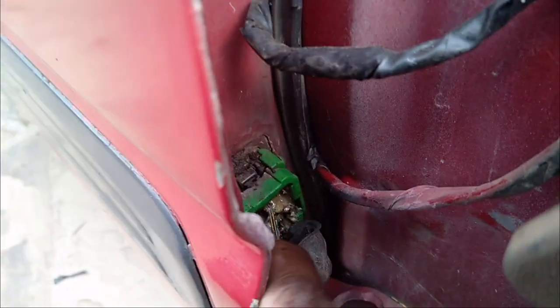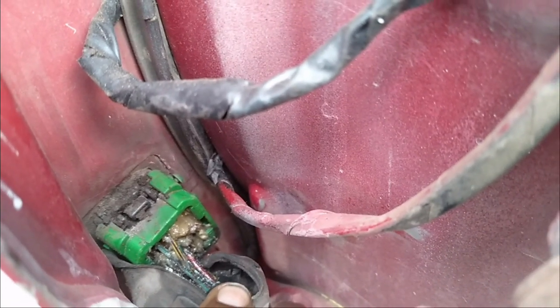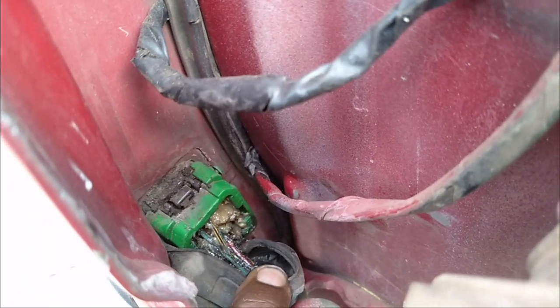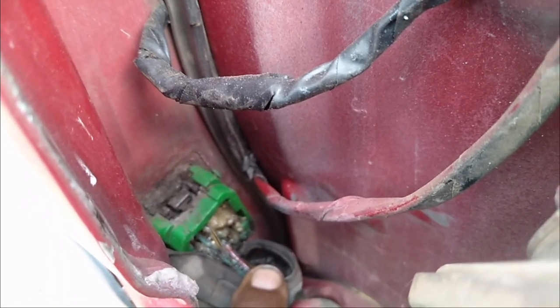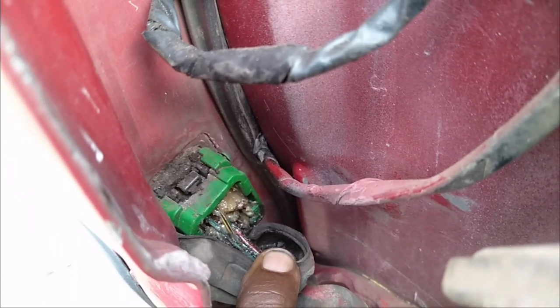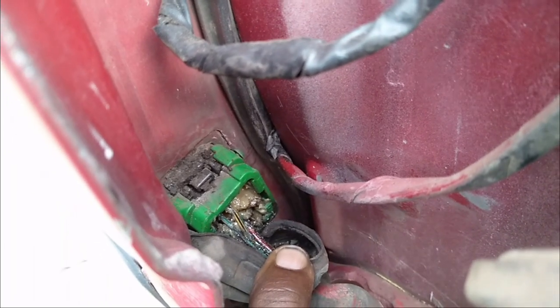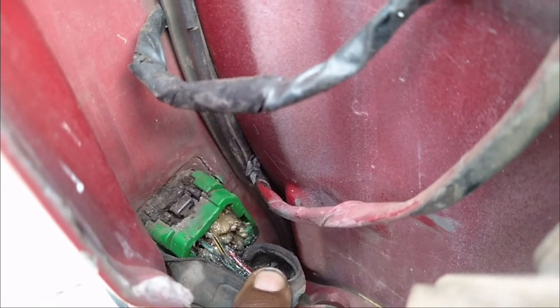So let's go ahead and see how it looks. Most of the problems with car door lock, mirror, side mirror control, power window, and central locking system stem from this socket. When these cables get loose over time due to the opening and closing of the door, the socket — which was not built to the proper standard — causes wires to keep falling out or getting disconnected.